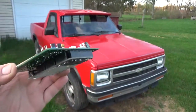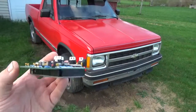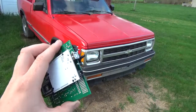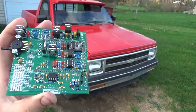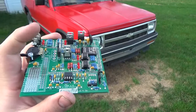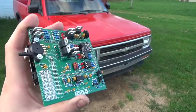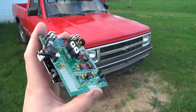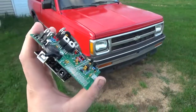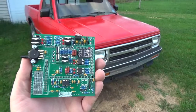This is actually the first one I've built. This Speeduino is going to be running on that truck. I've got to figure out if I'm going to buy an enclosure or possibly print one. It's a Speeduino 0.4 version, and I'm going to be selling these — as DIY kits, unassembled and unsoldered, or you can buy them built. You can also buy everything plug and play. My plan is for all of them to be geared towards the LS platform for now, unless you buy the DIY kit, in which case you can put it on whatever you want.